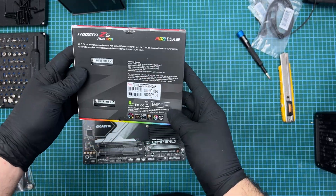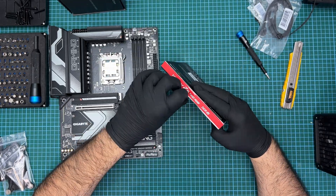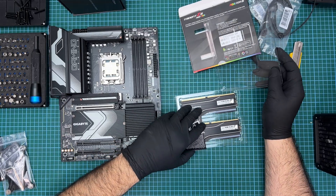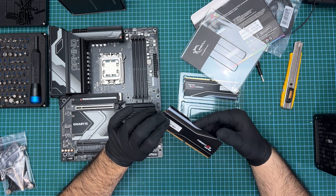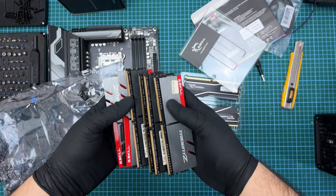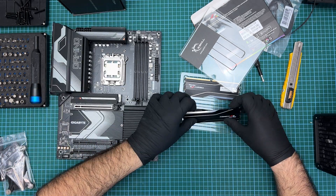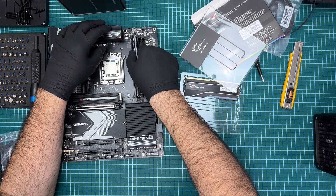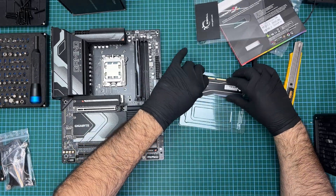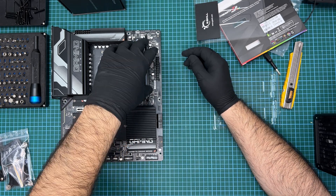And finally I need to add some DDR5 RAM. Unfortunately AM5 is DDR5 exclusive, so that means I can't port over my 64GB 3600 DDR4 RAM. Instead I opted for a 64GB kit of 6000 Mbps CL30 RAM that I overpaid £48 for, as it went on sale literally the day it arrived at my doorstep. Please be aware that DDR5 and DDR4 are really not pin compatible, so you should never try to use DDR4 in a DDR5 motherboard. The only real mechanical difference I found is that DDR5 is a lot harder to push into the slot. This isn't just my experience — it seems like a conscious design decision. This is the third kit of DDR5 I've ever used and all of them required a lot more force than any previous memory standard to sit correctly into the receptacle.